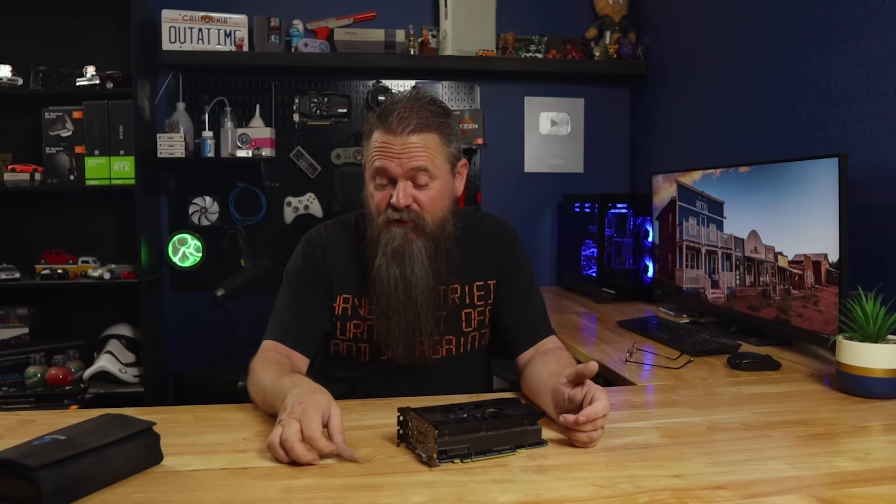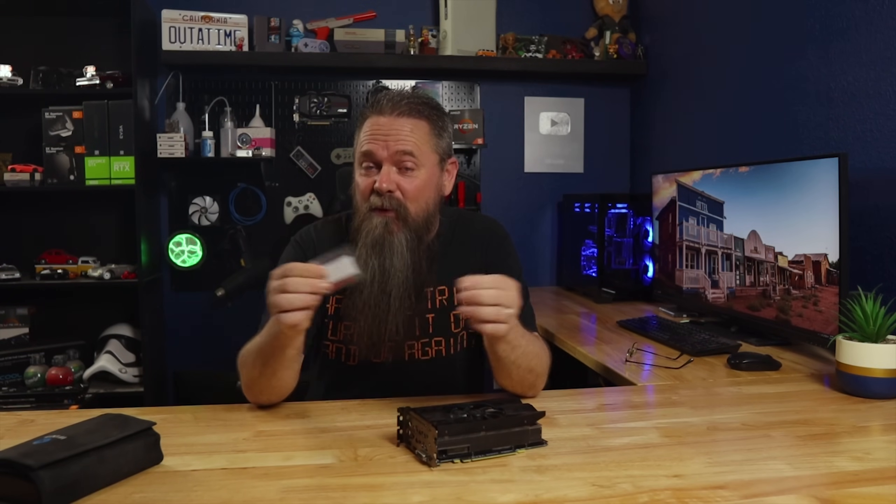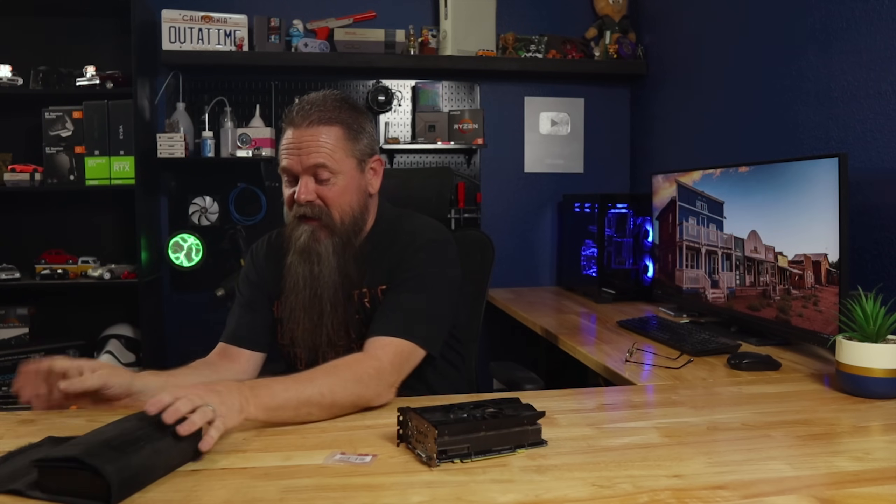Since they're made out of a fiber material they work perfectly for increasing the spring pressure on a GPU. The results were a lot more dramatic than I thought they would be. To do this you'll need the fiber washers — I'll leave a link in the description. Unfortunately they're only available in bulk, so you'll have to buy quite a few, but you'll have lots of extras. You'll also need a toolkit; I'm using my iFixit toolkit here — not sponsored but still awesome.